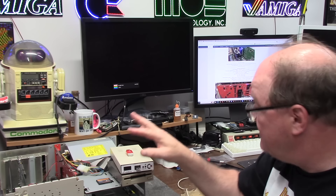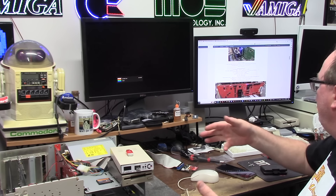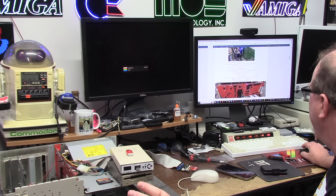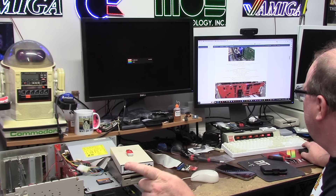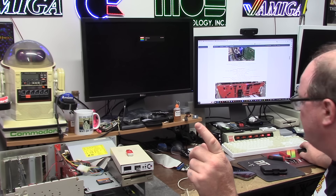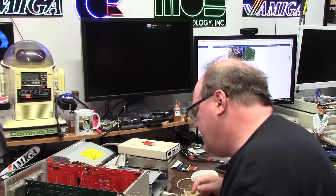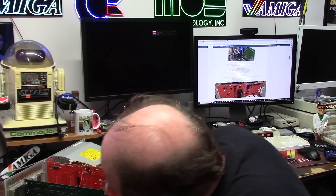B-key, big shelf B-key drive — super cheap. 2 clock ports: 1 fast clock port, 1 standard 1200 clock port. 68000 fallback mode — CPU IDE, 4 megs of fast RAM, which we found out when you flipped the little switch. Hard drive and the Delfina sound card fittings on the back side — 1, 2, 3, 4. And a 2.5-inch hard drive — you can mount right there — or M.2 SSD.